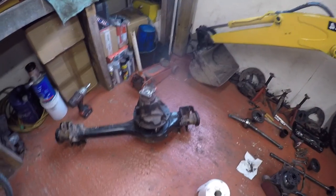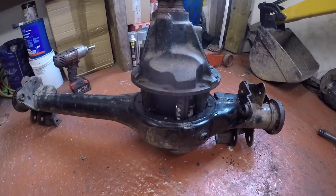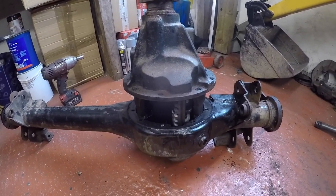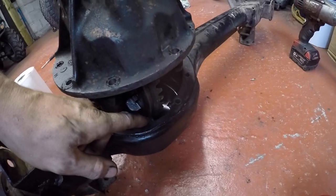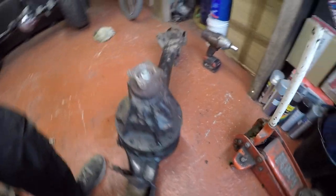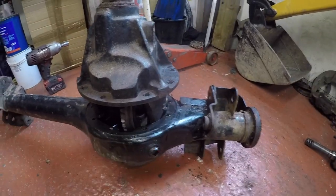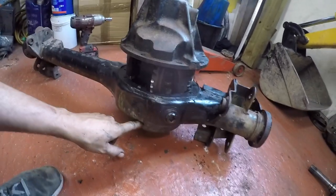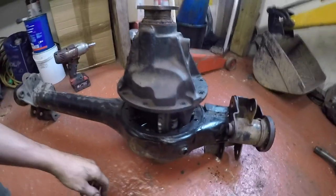When you place the diff on top of the casing — on the short nose four-pin — the crown wheel is offset to one side by five mil, so you have to grind this section out here, same on the top as well. Then you have to cut the diff pan off because there's a bit of grinding to do there, and you've got to space out the diff pan or put a different one on. I usually weld all these holes up first, grind flush, mark all the other holes up, and then re-drill.